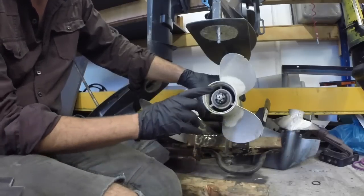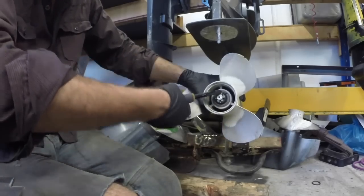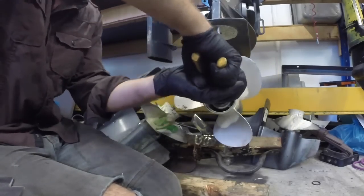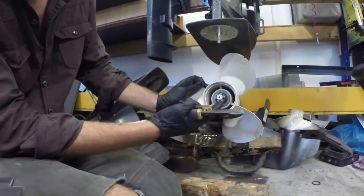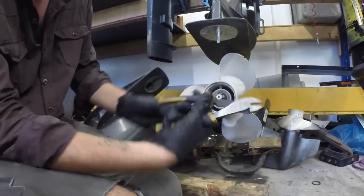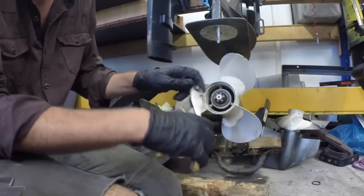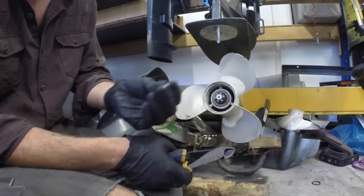Make sure you check that. So first thing to do is just take the old split pin out. This one actually isn't installed properly on this outboard — I'm not quite sure of the history of it but it may have just been put in temporarily. To do that you generally have to straighten the ends of the split pin as they go through. Then I use a pair of diagonal cutters like this just to get a really strong grip, cut a little bit into it, and then use the handles to lever against the nut and pull this split pin out.